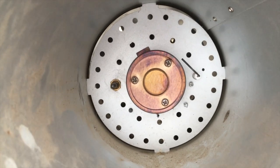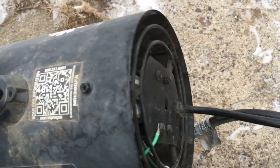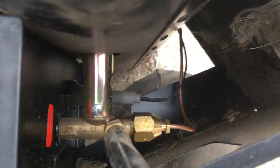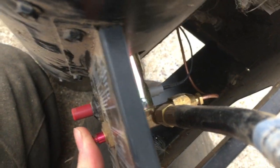The thermocoupler — which is very commonly the problem — that little guy there on the left is your thermocoupler. What you got to do is take these three screws out on the back and remove the fan. See that little copper line that comes down and goes into there? That's your thermocoupler. When you start this up, you push this in, you ignite it, and you hold it for a while.